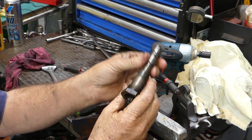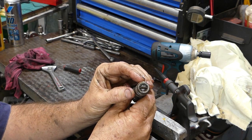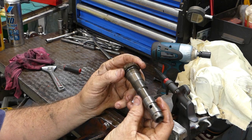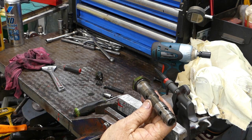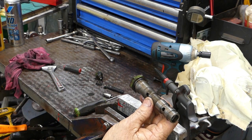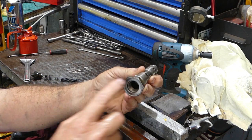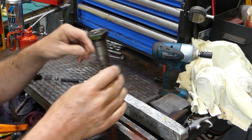Have a really good look at both ends at that roll pin. If there's anything wrong with that roll pin, ditch it and get a new one. There's an O-ring up here — whether you replace that or not is up to you, but it's probably good practice to do so. I'll take all this over to the parts washer, wash it all up and blow it dry, and we'll come back and assemble it for you. I've been over to the parts washer, cleaned the surface for the O-ring to sit, washed and blown and done all that sort of stuff.